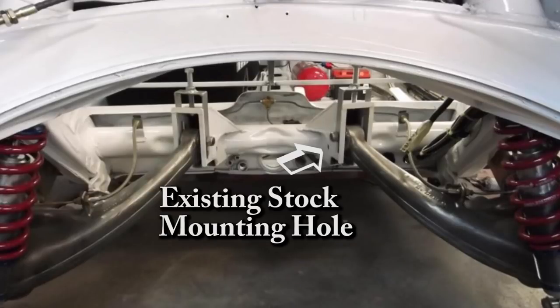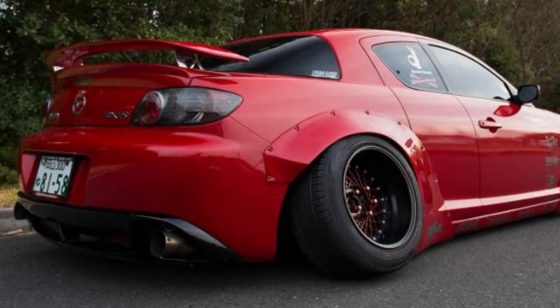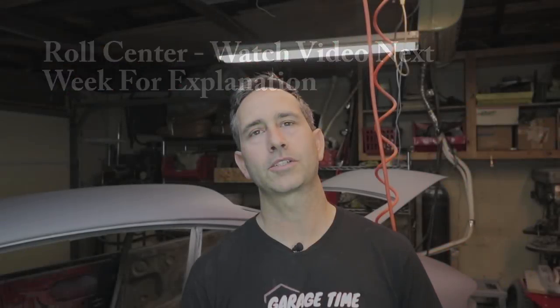The step above that is to build what is known as a camber box, and the camber box sits on top of the existing attachment point. By shifting the rear trailing arm up — at least on the inner connection — that changes a lot of things. Number one, it changes the camber. When you reduce the ride height of a car, especially something like this, even lower than the European heights, it puts the geometry in a less than ideal situation and the camber can be too high. It also changes the roll center and the squat characteristics under acceleration and braking. So I feel like it's a worthwhile upgrade.